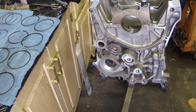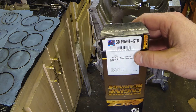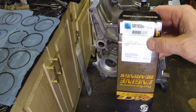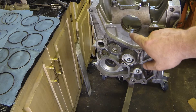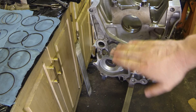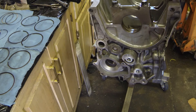I'm aiming for anywhere between 1.8 and 2 thousandths of an inch. The bearings I'm using are ACL race bearings. There's also a part number 5M1959HX — the X stands for one thousandths additional oil clearance, meaning the bearings are 5 ten-thousandths of an inch thinner. That'll give half a thousandth on the bottom and half on the top for a total of one thousandth combined. At 7 ten-thousandths clearance right now, throwing in a set of X bearings should put it right around 1.7 thousandths — which would be optimal.